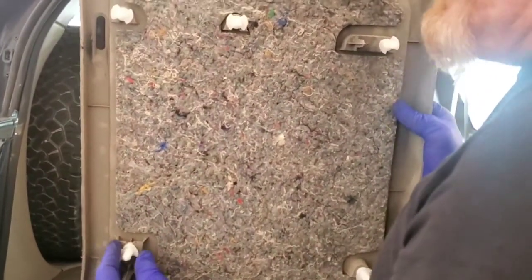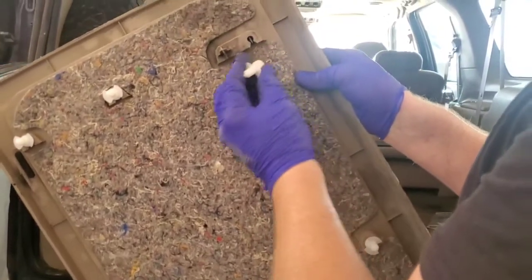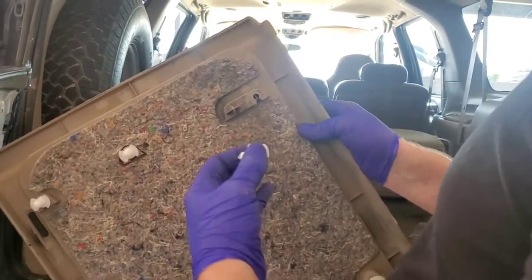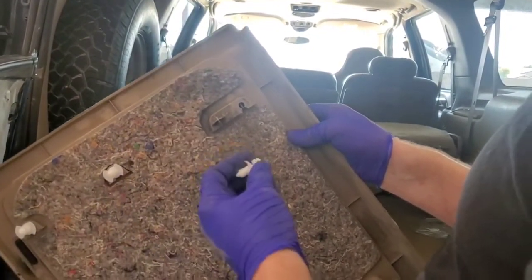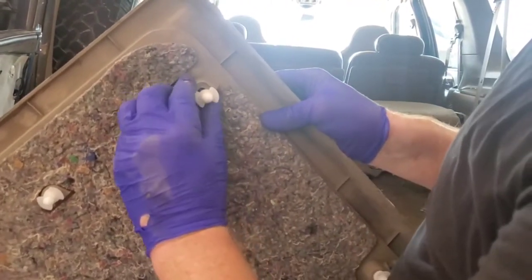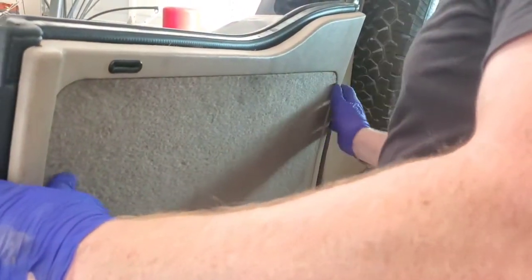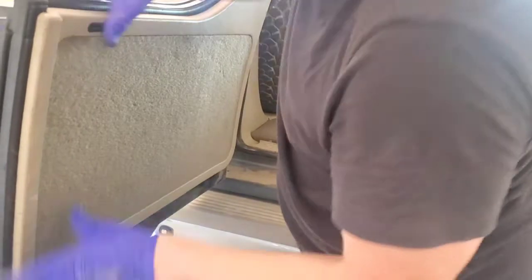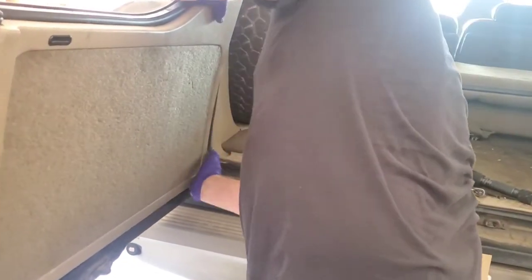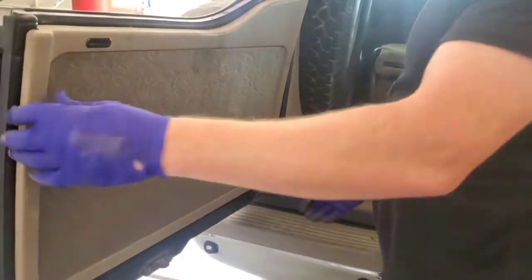I did use some new clips, so the new clips are installed. To install the clips, they just slide straight out of the old panel, and when you get new clips — which you can get off eBay, Amazon, your auto parts store, or the Ford dealer — the little tab in the middle: slide it up and just pop it into place. Now all these retainers are brand new so they'll lock really good. Pop it into the holes and make sure they all snap — use a little bit of force because it does take extra pressure. Run your fingers around the base just to make sure there are no openings or retainers that didn't lock down.